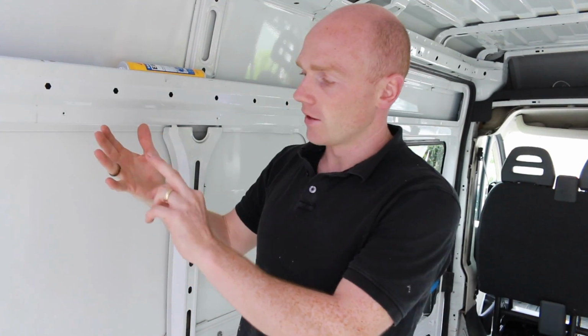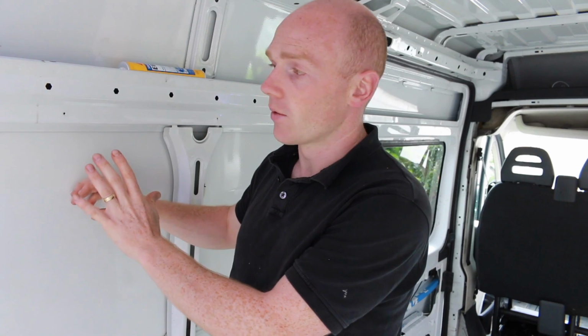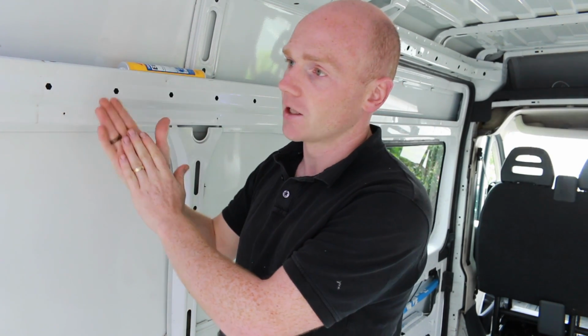But of course then we're going to be insulating here, so between the butyl type sound deadening and then the soft insulation which we're going to use, and I'll cover that in another one, and then we've got another layer of vapour barrier insulation. There's kind of 3 different densities of insulation, so they should cut out a lot of the frequencies. Well, that's the plan.